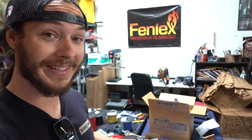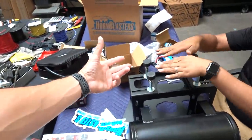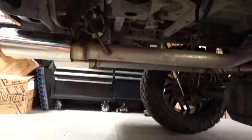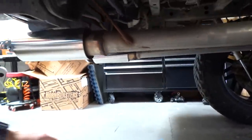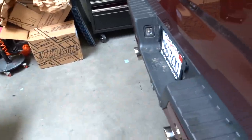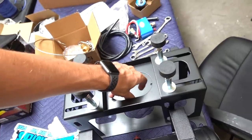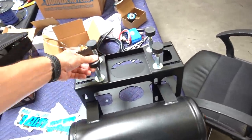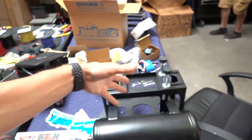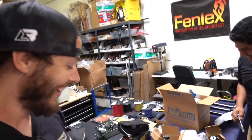I'm not gonna call this an affordable option — we'll get into the price of this setup in a minute, it's gonna blow you away. Basically what this kit does is the spare tire removal relocation kit. So you remove your spare tire — which might already be off — and then you use that little hanger right there. That's what drops your spare tire down when you crank on your little spinny thing that comes with your jack. What this kit does is you take that piece, it enters into the bracket here, and then you crank it back up.